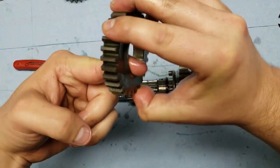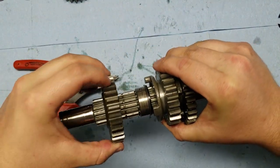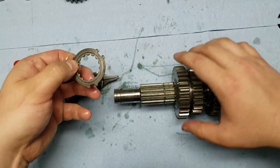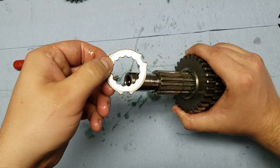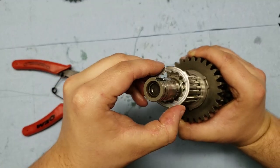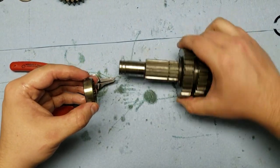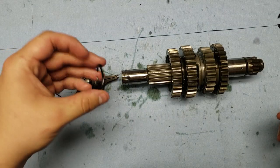Now we have the second wheel gear — again we're going to have to orientate this on here so it mates with this one. Go ahead and put that on there, make sure it slides pretty smooth and actually makes contact with that gear. Now we get the tooth retainer — put it on there. You can kind of tell the wear pattern on here of which direction this was already on, so mine goes on this way. Now we get the lock washer and put it on there, make sure it's in the same orientation so it'll mate with the retainer. Now we have the tooth collar — go ahead and put that on, remembering that there is a hole inside the shaft right here. And now for the last snap ring.